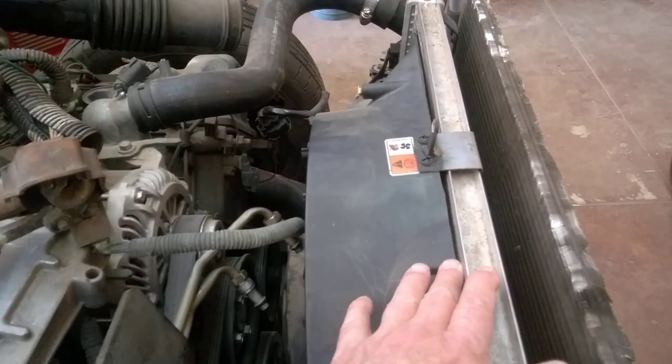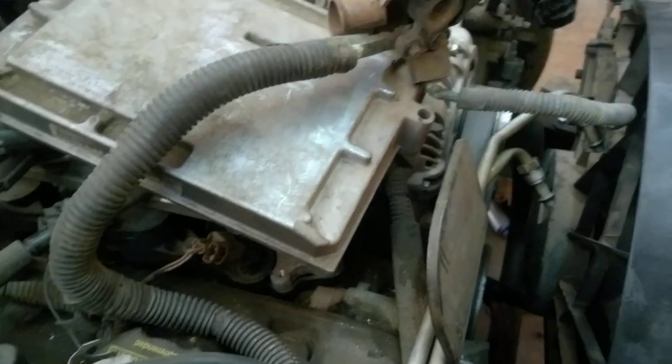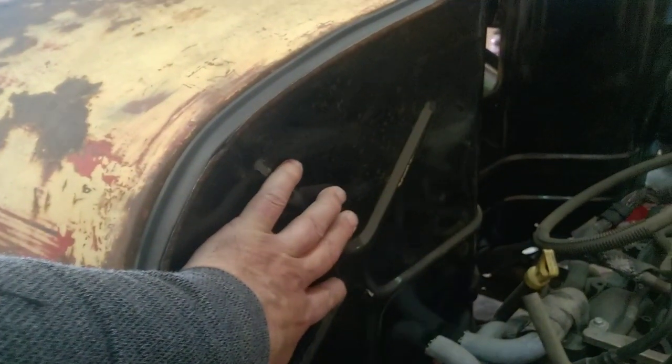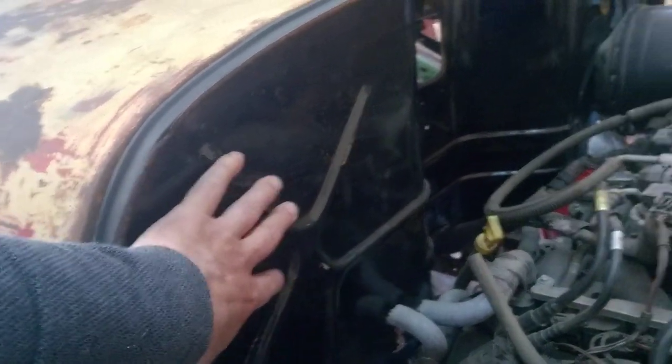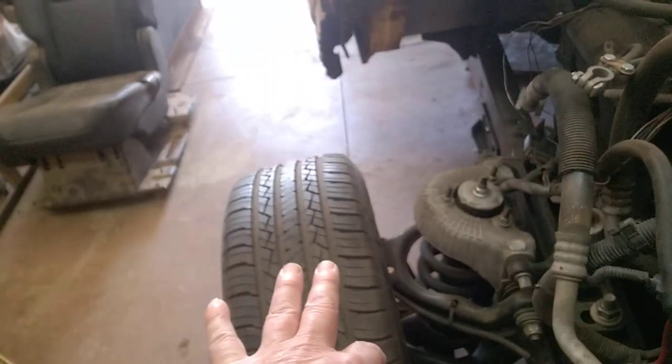You'll find if you try this, you've got about four inches of extra plastic right in here, which we trimmed off, and we're able to get about an inch and a half to two inches of clearance for the electric fan. Going back to the engine, we thought maybe we could use the cop car air conditioning components and that fan, but it's just too huge. We only had a little bit of trimming on the inner fenders — not bad at all.